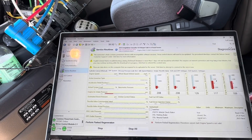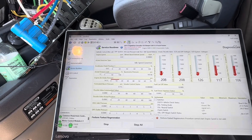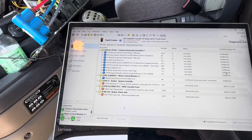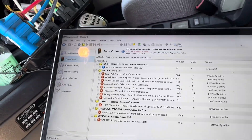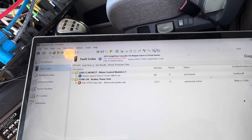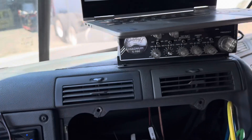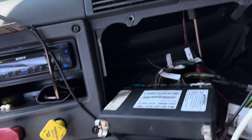What I want to do right now is perform a road test and see if this actually worked — if I am getting speed registering up there, that means we've got a bad CPC and we need to go ahead and replace that. The malfunction light might come back again because the CPC is not programmed specifically for this truck. It may return, it may not, but I'm going to do a road test and show you guys what we find. There you have it — bad CPC. If you liked the video and it helps you, thumbs up, like, subscribe. Thank you.